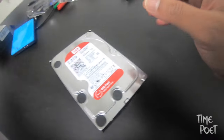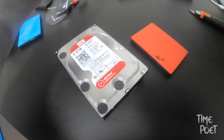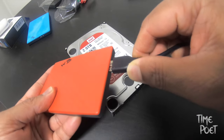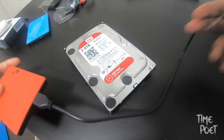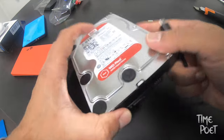Now if your hard disk was a 2.5 inch hard disk drive, you might be able to easily transfer it with just a simple adapter and no power at all. But if it is a 3.5 inch hard drive, the answer is no — you will not have enough power with just a USB connection, so the transfer wouldn't happen at all.